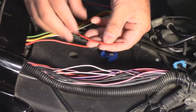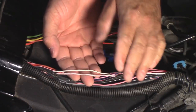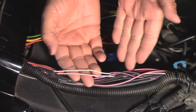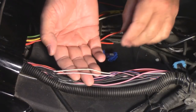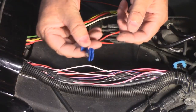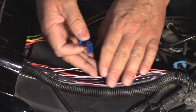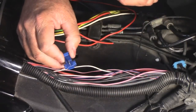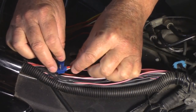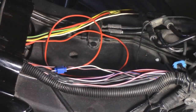The small red wire on the isolator is for the brakes. The white wire with the pink stripe on the harness is for the brakes. There happens to be 2 of them in this bike. They're both active brake lines. Pick the one you want to use. I'm going to use these blue taps. You can use whatever you like, but I happen to have these things lying around. When I install these, I'm going to stagger them around so it doesn't have a big bulk of them in one area. I'll put a complete list of the wire colors in the description box below.